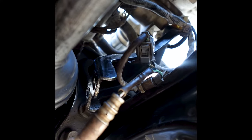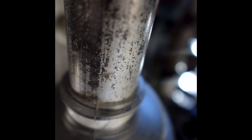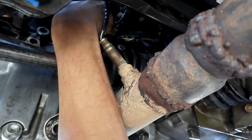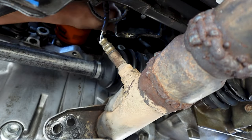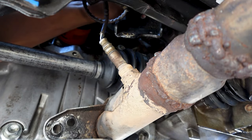The bracket is just kind of pushed out of the way right over here. Now I'm going to try to get to this black PCV box. There's a 10mm right there that connects it to the block, and a 10mm right over here that connects the wiring to the black box. There should be another 10mm up on top, but I'm going to get these two easier ones first before removing that top one.